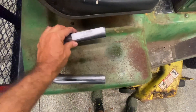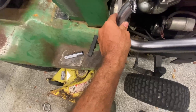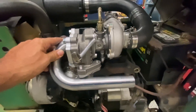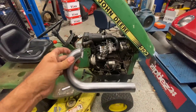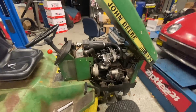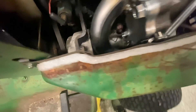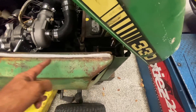Just like that, it's the next day and we've got our pieces of pipe. We've got this piece right here and this little piece I took off, so we're going to use that to extend it out. This is going to mount right here and basically create our downpipe. It's going to bring the exhaust forward and go right out the factory outlet right there. Let's tack this in place, get it all fitted up. Here's the downpipe in position - as you can see it clears the metalwork, and it's going to come right out the hole. Now we just need to extend it to the factory outlet and we're done.